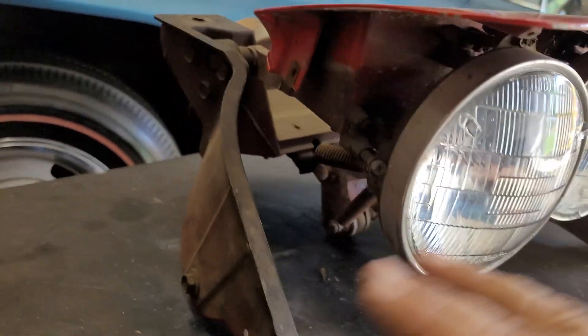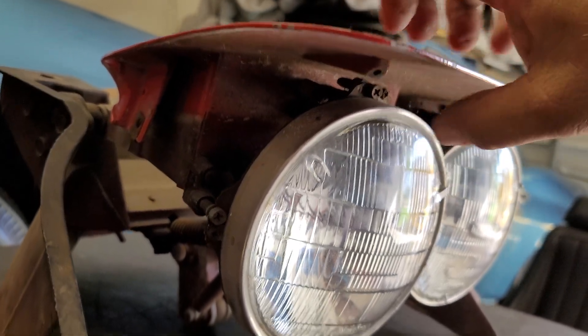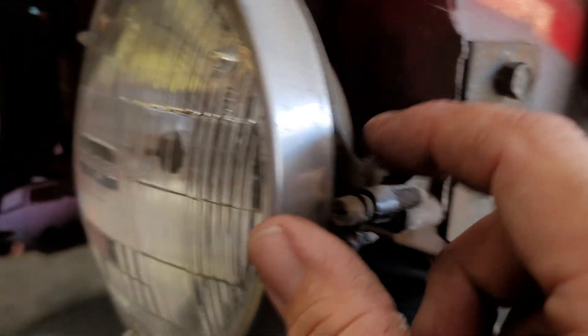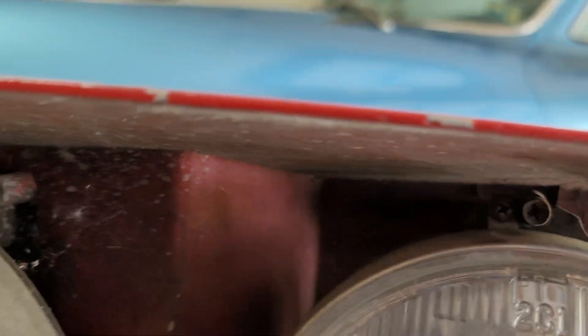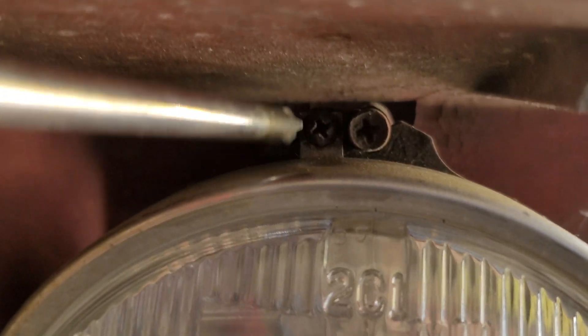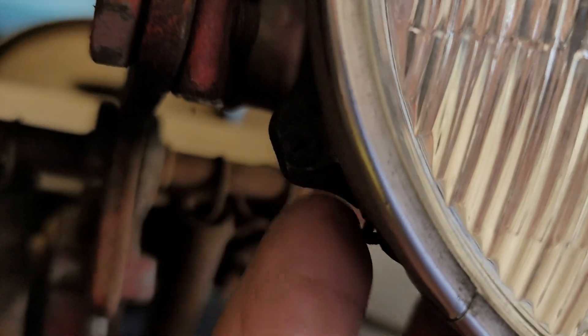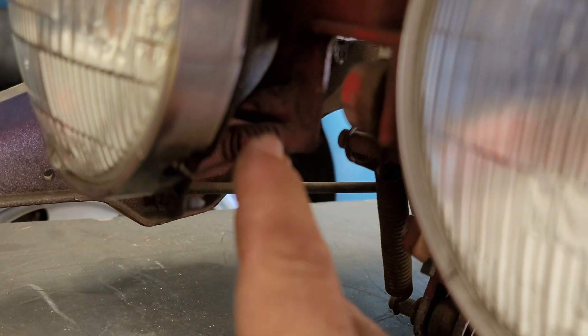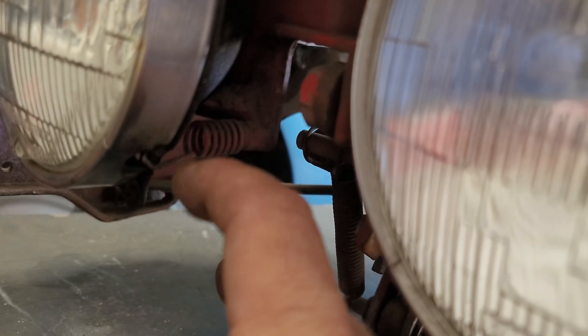Now you can get a better picture of what we're looking at here. The main pieces are: your mount bracket, then your actual headlight door mounting assembly which includes the headlights that mount directly to it. On the back side you can see the adjustment screws, and your trim mount is that little tiny screw right in there. To change the headlights on a C3, you take the bezel off, take this screw off on the left-hand side, there's another one tucked in that corner and one more right there, then you can get the globe out. The cup will stay installed inside the main housing assembly so you can adjust the headlights independently. All the old-school cars have a little tension spring in the corner - it's a hook right there in that corner.